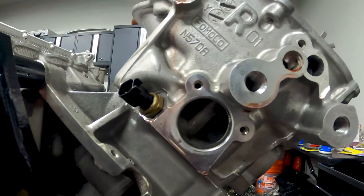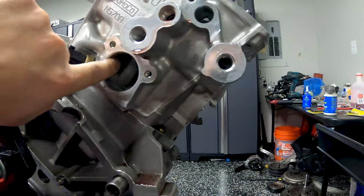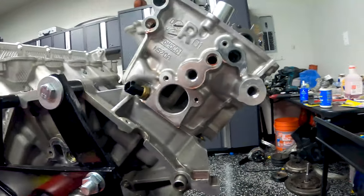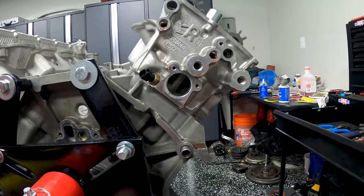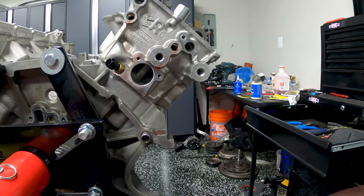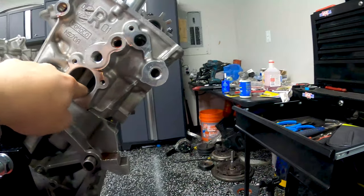Here's what it looks like in there — a big hole. One thing I should have mentioned at the beginning: throw your MMR little blocks that came with your kit into the freezer. Aluminum is billet aluminum and it shrinks when it gets cold, so freezing them gives you the best chance of pounding them in.